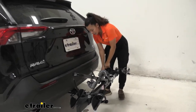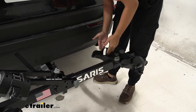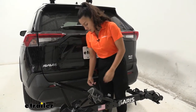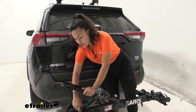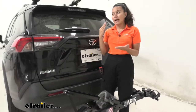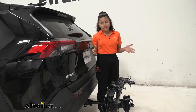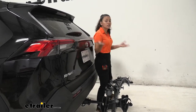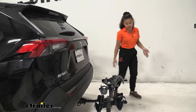We'll put these straps back in because even though your bike is off, I recommend putting those straps away so they're not flopping around as you drive. Coming over to the front, let's get that frame strap put away too. This can accommodate wheelbases of up to 48 inches — you just loosen these knobs and then slide the cradles back and forth. The cradles have a capacity of 2.25 inches, so if you have wider tires, this probably won't be the best option. There is a Saris Freedom fat bike version with wider cradles available if you need it.